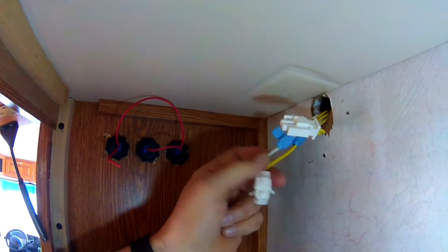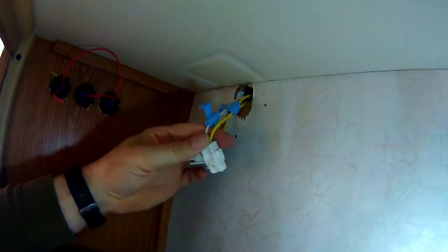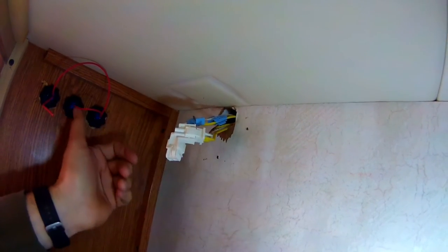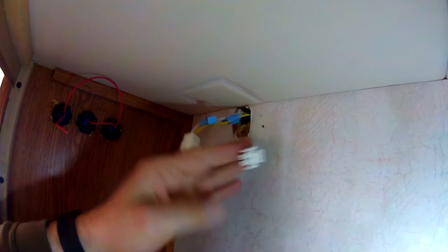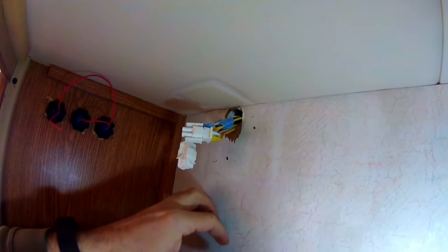I think there's more than enough capacity on this wiring to handle a USB charger and a voltage monitor. I used a multimeter to check which color is positive and negative — in this rig, white is usually always negative. Here's the plug for the lamp that was underneath that plastic corner piece. The rig has these plugs throughout every cabinet for lights and low-amperage stuff like a volt meter or USB outlet. They're on a 10-amp fuse already, so I'm fine just hooking in direct.